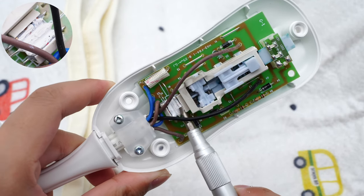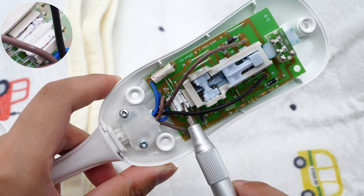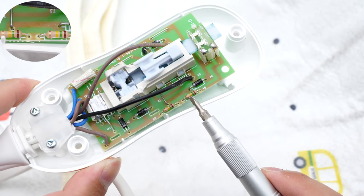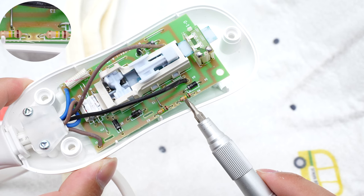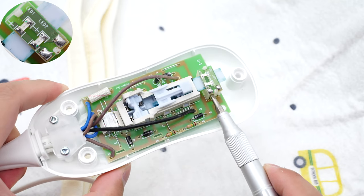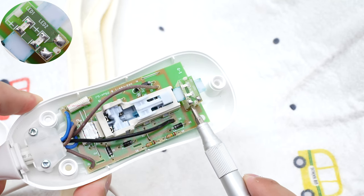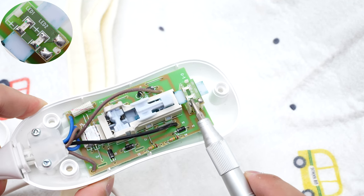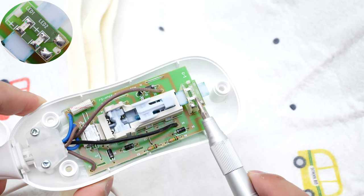There are resistors and thermal fuses used to protect the user. The rectifier diodes are used to adjust the temperature. Two current-limiting resistors for the LED indicator are connected in series at 150 kilohms, and two SMD LEDs are connected in anti-parallel to prevent excessive reverse voltage from breaking down, allowing them to glow on both positive and negative half cycles of AC.